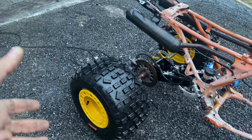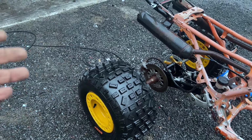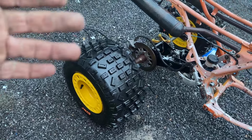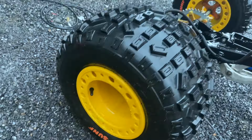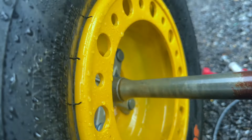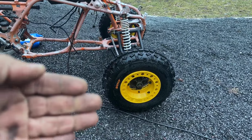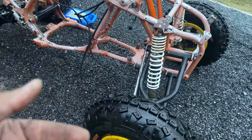Stock wheels in the back are still, I'm wanting to say, 8 inches, 9 inches, whichever. But these ones are 8 inch wide and they are plus 5, so they stick out further. And 3. So if you'll see, 5 inches are on this side of the plate, and then there's 3 inches on the other side, on the inside. So more shallow mouth in there. These are 5 inches up front, and it's plus 2, and then 3 in the back, I'm wanting to say. So they stick out a little bit more.